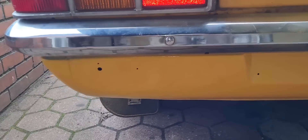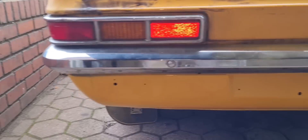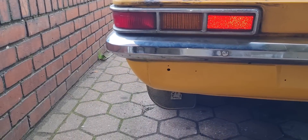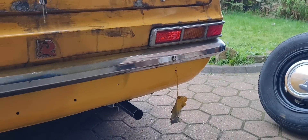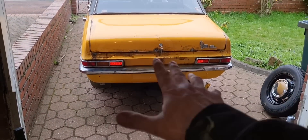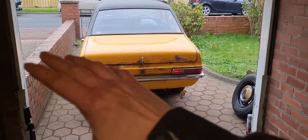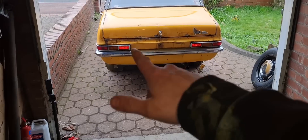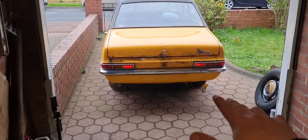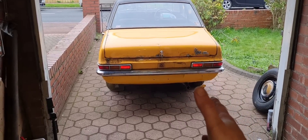It's a rush job and it's far from perfect. I could just do shots of the corners when the light's hitting it all nice and glossy — look mint — but no, I'm not doing that. It's not perfect, but I like it, it looks good. There was a lot of rust in that area, and with rust converter it was very black — it looks nice now. I love the survivor look, but it looks lovely painted up. Imagine if I took my time! If you're doing it, make sure you leave 24 hours with the base coat and primer. Time will tell if anything reacts. For now, let's chuck the number plate on it — the paint's still soft, I'll be very gentle. Let's do the before and after!